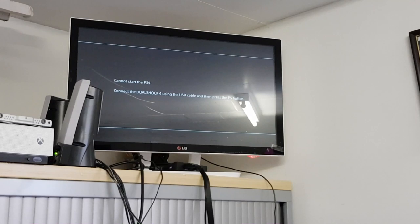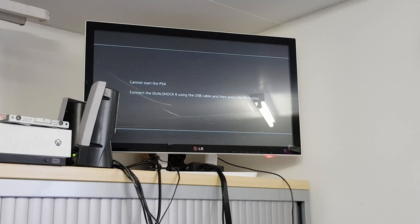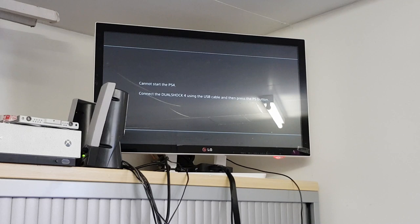So this has got a test hard drive in it, obviously, because like I said, these are just a mass purchase from somewhere. They don't tend to come with any hard drives in them, so I just put a test one in for now. We can see it started up to safe mode, and we've got the cannot start the PS4 message, which is actually a very good sign, because in fact, if it couldn't see the hard disk storage, then of course we would get the cannot access system storage message, and we'd be prompted to shut the PS4 down and reconnect the hard drive. So the fact we've got this far is encouraging.